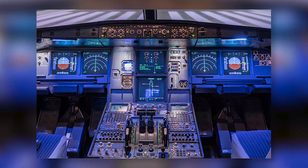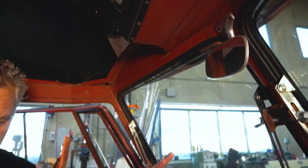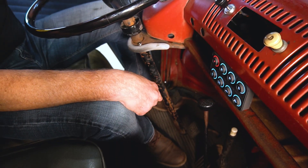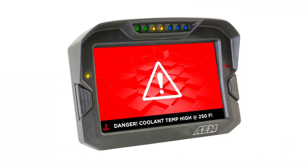Before this vehicle and a lot of others just had some switches or knobs to get in and out of gear and neutral, but you didn't get a lot of feedback on what gear you're in. Now we've added our keypad. When you turn the vehicle on with the wake switch, you hit the ignition button — the vehicle comes up to high voltage — and then you select your gear. The CAN keypad feeds the VCU, which feeds the dash, and up in the dash is a big P for park, N for neutral, R for reverse — no guesswork. The CD7 and CD5 are used in motorsport; they tell you how well things are working, and also warn you when things go wrong.